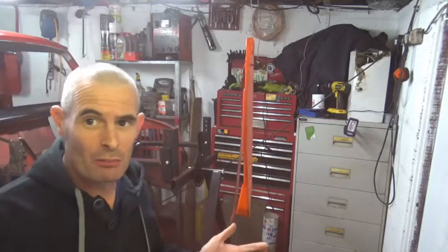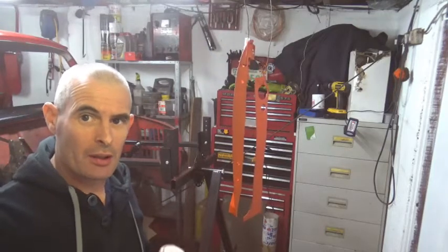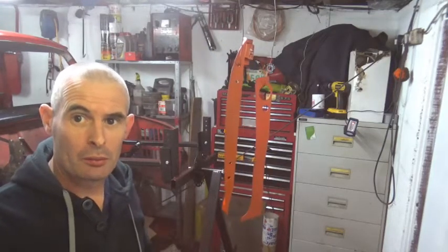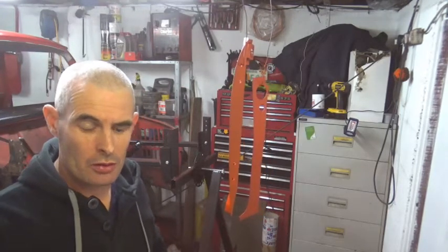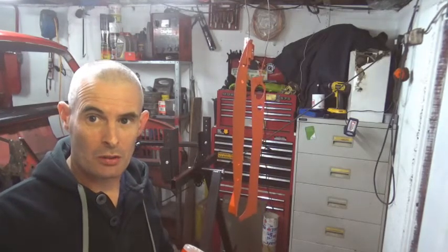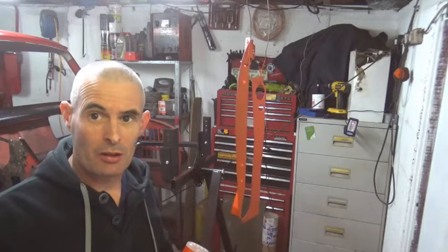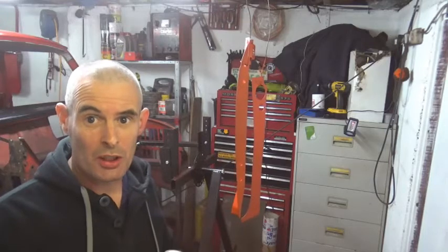This may not be totally necessary, but the whole idea is just to try and get paint in behind areas that I won't be able to reach when I weld. And obviously I will burn off or rub off the areas where I'm going to weld it onto. So that way at least the majority of the panel at the back has got ample protection on it, rather than just leave it the etch coat or bare metal. So I can only do what I can to help preserve the car, because that's what this whole project's all about.